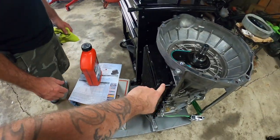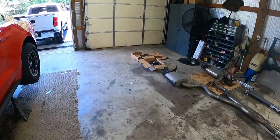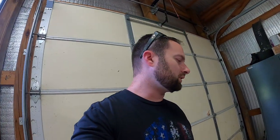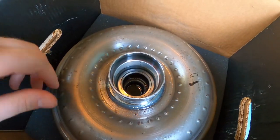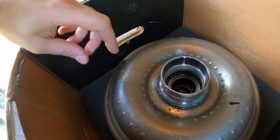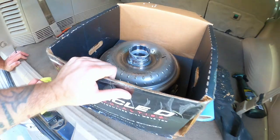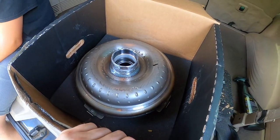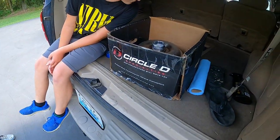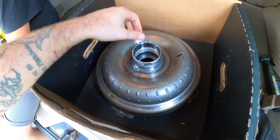I was talking to Danger Russ on YouTube and he said it's happened to him a couple of times. My buddy Ken told me - if you think there's any metal in that thing, definitely do the valve body. Maybe later we can cut this open and just take a look at it. So there's the stock converter - this bushing is completely smooth. It wasn't the second-gear launch that did it because it was actually doing it in first gear earlier that day. The way it was all mangled up, it's been like that for a bit, just getting worse and worse over time.